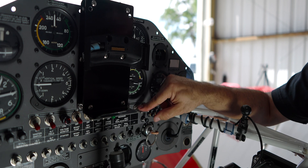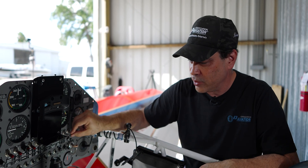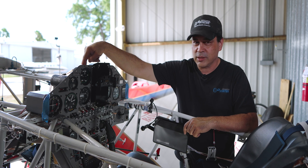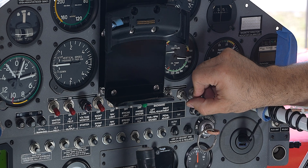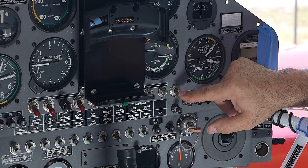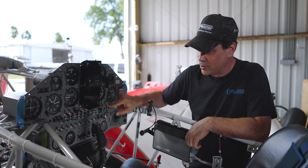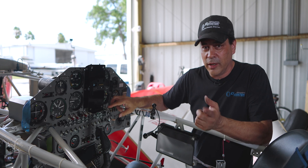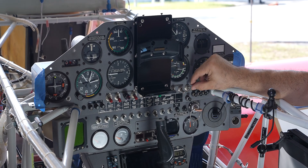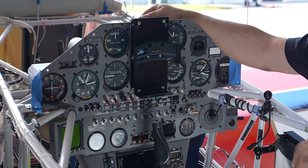So we have two switches. On this side is a single-throw but three-pole switch — three poles in the back of it — and those are attached to the relays we talked about. It actually dictates whether that pump is going to run in reverse or forward, based on two relays that these switches are connected to. This left switch is for when we want to fill the tank with the hose going down into a five-gallon bucket of smoke oil. We flip this switch on, and because the activate switch is off, the relays know which polarity to send to that pump. So when this left switch goes up and the activation switch on the right is off, the pump will run in reverse to fill. The opposite happens when we go to fly: when this switch is down, the relays switch over so we can activate the system on the right-hand side, and it runs the pump forward to send the oil down into the exhaust system.